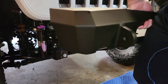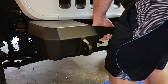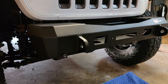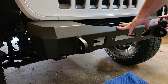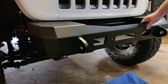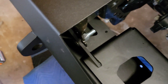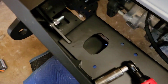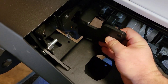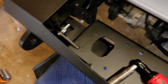Sorry — missed a big moment, but the bumper is up. It has a lot of slotting on the bolts left to right, but that's the first view of it on the vehicle — it looks a lot smaller once it's on. Grabbed the nuts and started putting it on. All I've done so far is snugged up the two bolts that are super easy to see with the electric ratchet. Now I'm going to line up the winch support brackets that go down on the inside of the frame, and make sure my reservoirs, shocks, and everything else don't get in the way — these are nylock nuts.